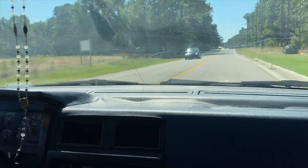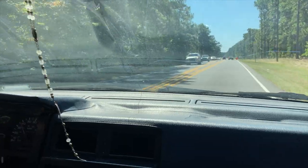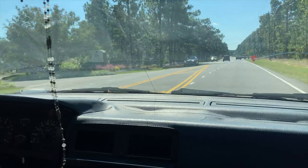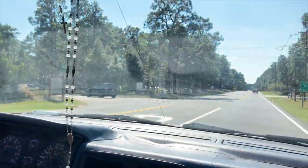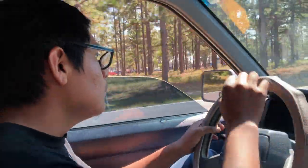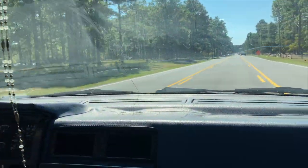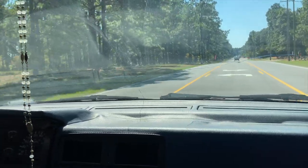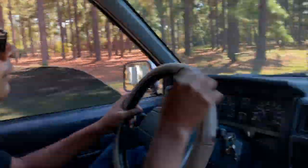The sound's gone. She's a little bumpy because she's lowered now, but nothing that some Bilstein shocks in the future won't fix. She rides pretty good - a hell of a lot better than mine. We actually left with the four-inch drop on this truck. The bushings are probably shot, but we set the driver's side to 25 and a half inches from the ground, lined up from the center of the wheel to the inside of the fender.